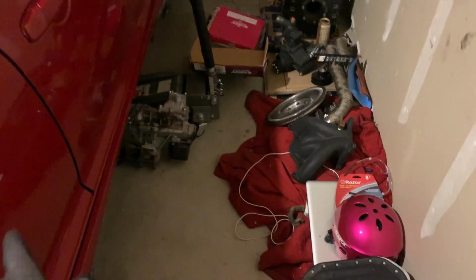Okay, so I think I'm gonna get to a stopping point now. Flywheel is installed. So I need to torque down the flywheel nut. My torque wrench only goes to 150 foot-pounds, so that will not do. I mean, you could probably send it like that, but half the recommended torque spec, not good enough for me. So I'll see if I can just stuff in my old clutch. See if I can rent one from like O'Reilly's or something tomorrow, and then torque it down, and well, get my clutch and pressure plate installed, and try and get this trans out from underneath the car, because if I can get this from underneath the car, that means I can get my other one into the car, and I won't have to drop my trans again.